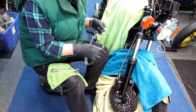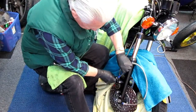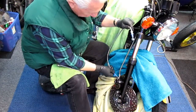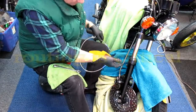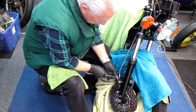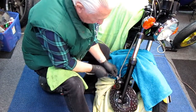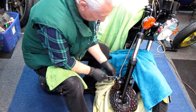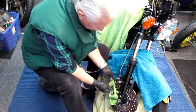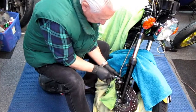I want to make sure I can route this the right way. The first thing is just to pop this off — it's going to make a mess with brake fluid and there's not much you can do about that. The thing you don't want to do right now is squeeze the lever while this is loose, so you just make a mess all over the shop. I have brand new washers for this. When we're all done, everything will get cleaned up with the brake part cleaner.